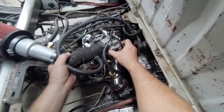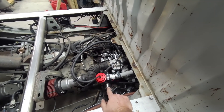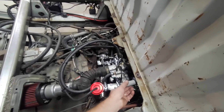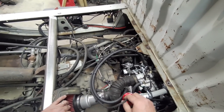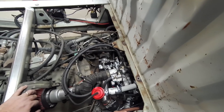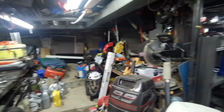That's where it ends up because that carburetor being away - if I went that way too much further. Got that tapped in there, used silicone to seal it. I need a one-inch steel piece of pipe that's like direct burial EMT stuff, so I gotta pick that up. It's on the suction side so there shouldn't be a problem. Temporarily I don't know what it'll do under fuel when gas gets on it. I got my vacuum line hooked up - that's all hooked up under there. Got a little elbow - I'm hoping that doesn't collapse or I'm gonna have to get a brass tee with little short connectors.